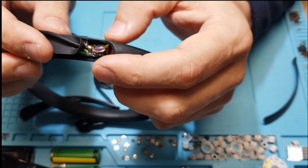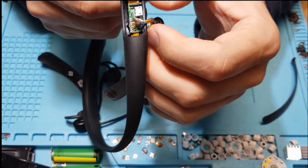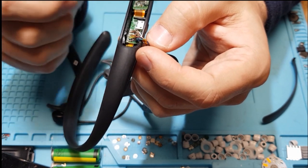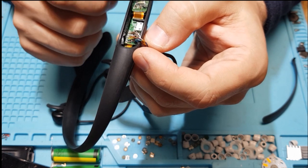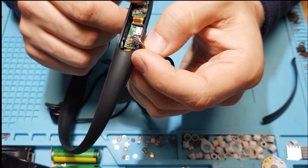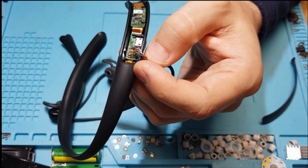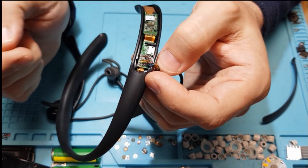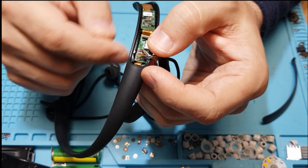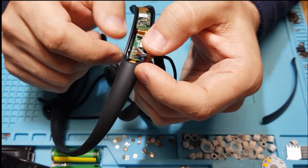An important tip: don't forget to take pictures of the repair you're doing, especially of the cables. I was taking pictures, but somehow after redoing everything and wanting to solder everything back, I found that one picture of the middle row was missing. Don't forget to check that your pictures are okay — good resolution, nothing blurry — before unsoldering each step.